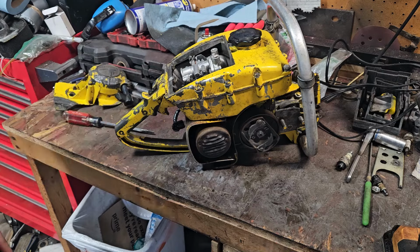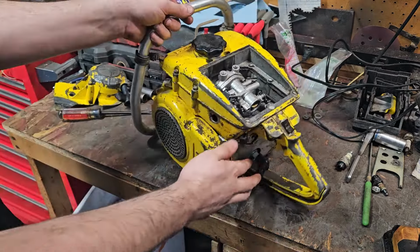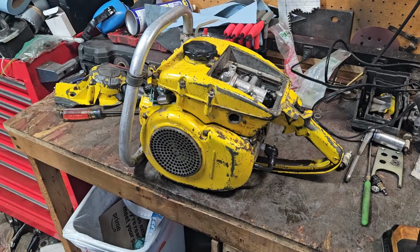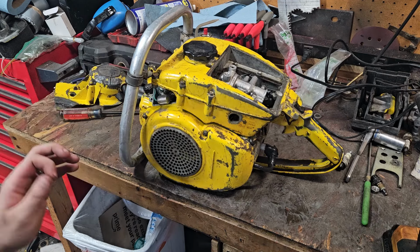So there's a spark leak. I don't suspect the coil at all at this point. It was just spark leak, and those points are just beyond finicky. I did spray WD-40 down where the rod is to soak for a while. Just cleaned it off with carb cleaner, everything, and stuff like that. And so all that should be nice and happy, but it just wants to be finicky.